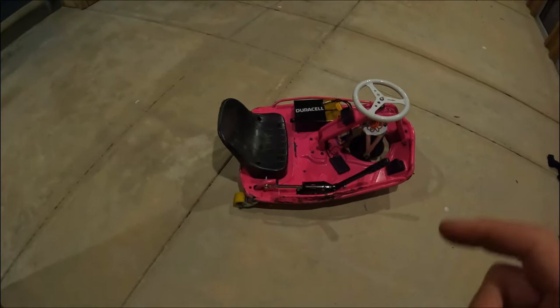All right, so next up, let's get into the setup that I'm currently running on the cart. All right, so here we have the brushless motor kit from Charged Up 3D, also known as Jeremy in the Crazy Cart Modders Facebook group. It is a brushless motor paired with a Flipski controller, fully tunable, connects to Bluetooth on your phone. You can see your battery life, how long you have left in terms of miles. It gives you an estimate of range, tells you a whole lot of useful information about your battery itself, your consumption, all that kind of stuff. And the tuning capabilities are just crazy.